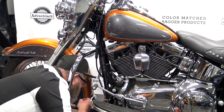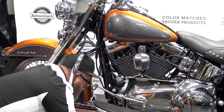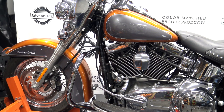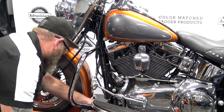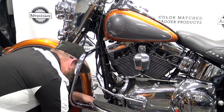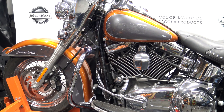Just going to make sure that this is to the inside. We're going to have to squeeze this a little bit to make sure it's to the inside. That's the reason why we leave the top loose, so we can just kind of move this around. We're going to put our bolt, washer, and nut on the back side. Go ahead and do the other side, tighten this down from the bottom up. Do the same thing to this side, then back to the top — reach in with our ratchet and socket and tighten this top down.